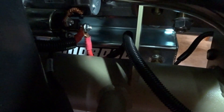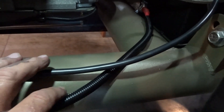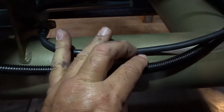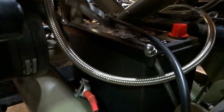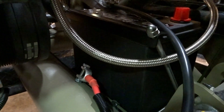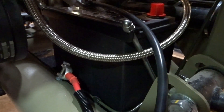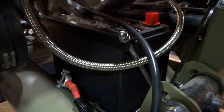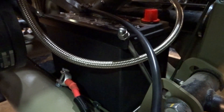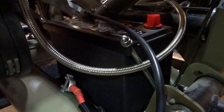As you can see, back in here is where we've got our positive cable tied on. We're going to wrap it around the engine mount here, and on this side we'll probably put split loom on this as well. They'll be side by side — I'll probably put a cushion clip here and one over here just to keep them in line. I've got the negative battery cable on the post. I haven't gotten to the testing phase, so I've got to make sure I don't connect both of them before I have a chance to check everything and make sure everything is wired correctly. Just don't connect both of the cables until you're ready, and keep those little plastic caps on your battery terminals so you're less likely to short anything out or drop a wrench on them.